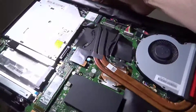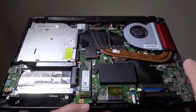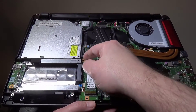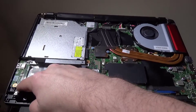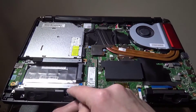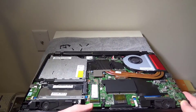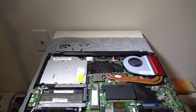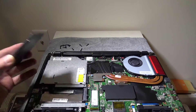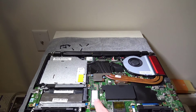Now that we're inside the laptop, you're going to see a couple of different spots. On the left hand side, you're going to have your second hard drive bay, and the rails top and bottom are held down by four screws. You'll unscrew those, screw your hard drive into the rails with the four screws included in the laptop box, and then plug it right in. Very simple and easy to do. You should have no problems adding an SSD or mechanical hard drive into that bay.